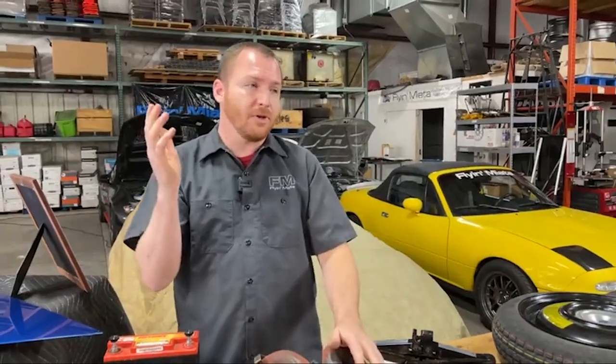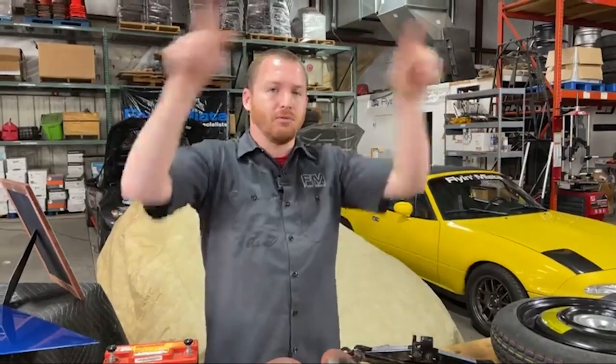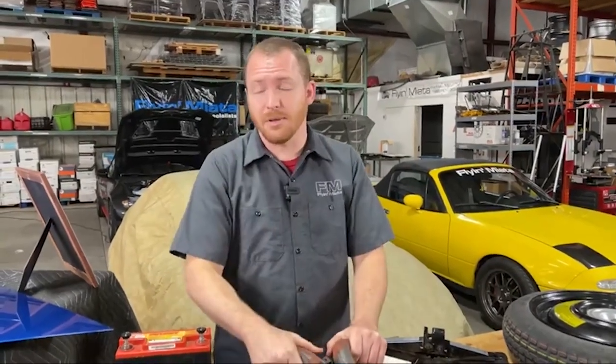A lot of questions about this one: what if you remove your soft top from the car? Say you've got a hard top or this car lives inside and you only drive it on the weekends when it's nice — roughly 35 pounds savings. So pretty significant weight savings on the soft top. The one I measured was a plastic window, not even a glass window, so you can save a few more pounds if you have a glass rear window too. If you have an NC or ND, I haven't weighed one of those, but I would imagine they're probably similar or maybe slightly less because they are a little bit smaller than the NA/NB tops.